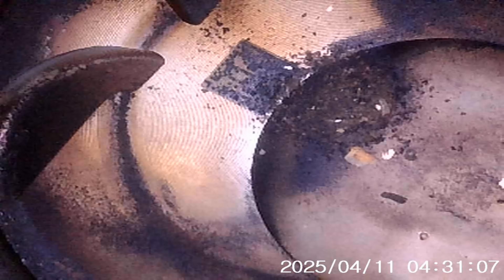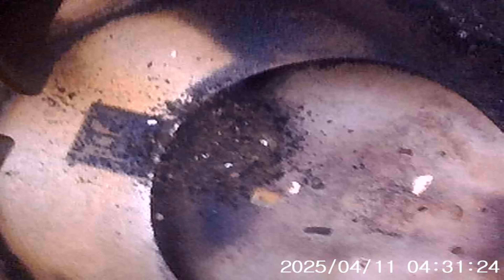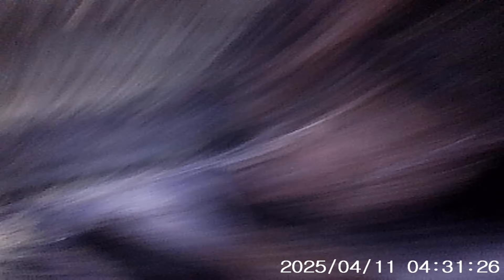All right, video — I'm going down. I knocked some debris down in here, probably knocked some on top of the piston too. Yeah, there's a little bit right there. Piston does not look bad — not for 80,000 miles anyway. I'm going to have to blow all that out before I put everything back together. That's cylinder number one — pretty clean for 80k.